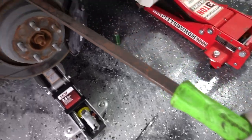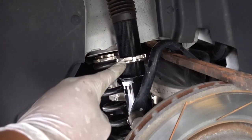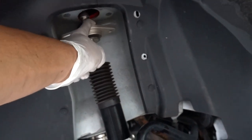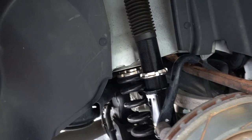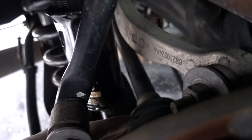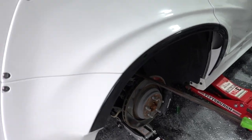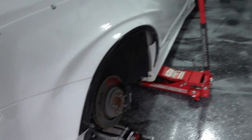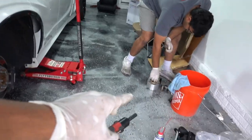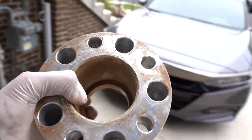So here's how we actually got the coilover in: we loosened it to its shortest length, then pushed down on the entire assembly to get it in, and now we'll adjust it to height. Once the top part is tightened up, we'll adjust the full height and bolt everything back up. There is now a bunch of clearance between the boot and the coilover — this boot is not ripped — and this is exactly why I went ahead and did this side proactively, so it wouldn't rip. Tightening up the strut bar in the trunk is all that's left, and literally five minutes later we had this side done. I put anti-seize on the spacer as well, just to avoid the same issue as last time.